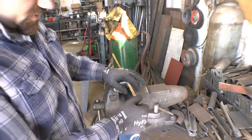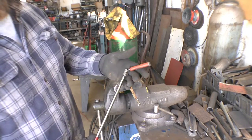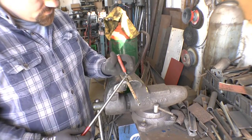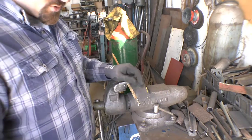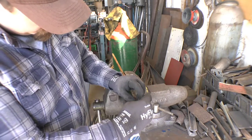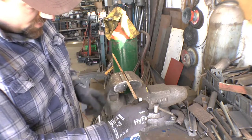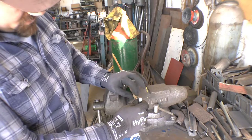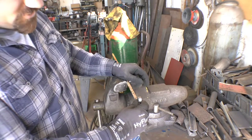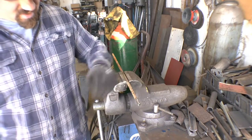After drilling my holes and running the bolt up through there, I was trying to fish the nut up through there and kind of reamed the hole out with the drill bit because I thought maybe I would try and weld the nut up in the frame. I've decided I'm not going to do that. What I'm going to do is weld my nuts to the end of these pieces of rebar, bend it some so it doesn't become too thick in there, then cut the rebar four inches so I can fish it back in the hole and get it started. The rebar will hang inside the frame and basically act as my wrench up inside the frame - I'll leave the rebar inside the frame. That's the plan.